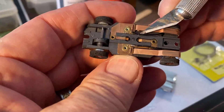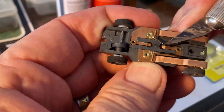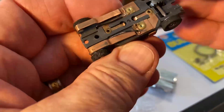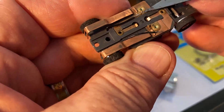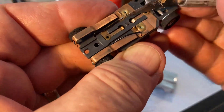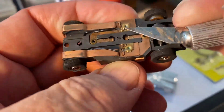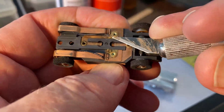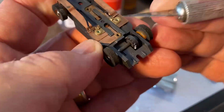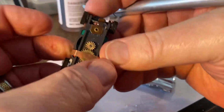To get the factory bulb out, rather than just pulling the wire, I'd rather lift up slightly on that little clamp holding it in — the wire should just come right out. I'll do that on both sides. Then I can just go ahead and pull the bulb out — oh, it went shooting out! Good. Let's get these wires out since we won't be needing those anymore.